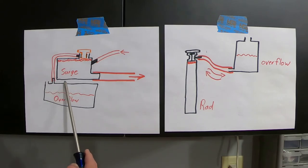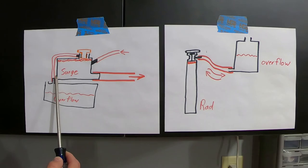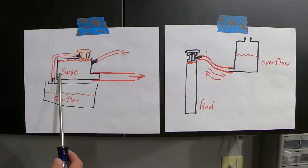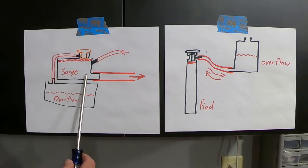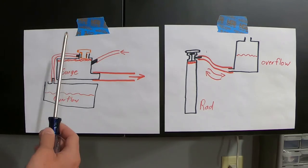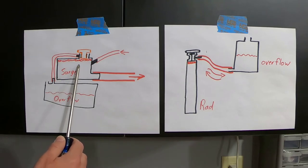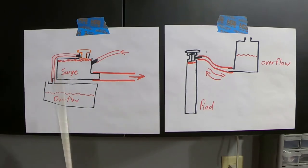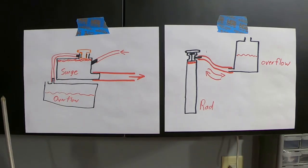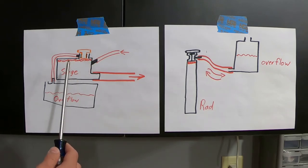So why do you want to keep the Camaro's surge tank filled? On Facebook I see it all the time where people barely have any coolant in there. If it's down really low, that's bad — you could be potentially pulling air into the system. You want to keep this full because if it's really low, it's all air in there. Air compresses really easily compared to fluid, so your cooling system won't be able to build the amount of pressure it normally should because the air is just going to compress. If you don't have pressure in your cooling system, that can lead to the coolant having more bubbles — cavitation. You want to keep pressure in your system because pressure helps keep cavitation to a minimum and helps eliminate hot spots in the engine block or heads. Keeping this at a full level will ensure that your cooling system functions properly.